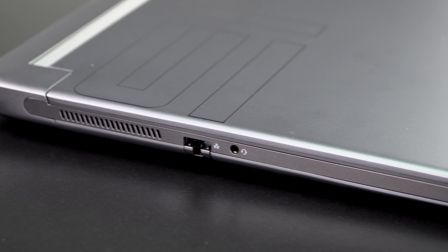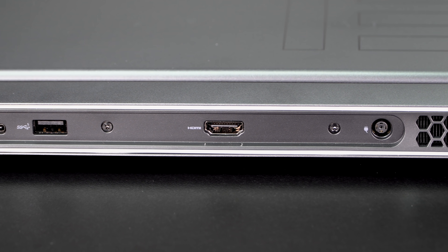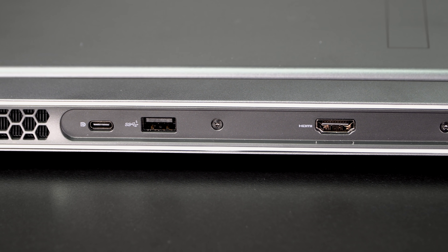We have 2.5 gigabit Ethernet on board, which is pretty darn nice. HDMI is 2.1, which means it supports 4K at 120Hz — for those of you with fancy OLED TVs. For those worried about the base model with no MUX switch and no switching to DGPU-only mode, which can be a hit of 5 to 10 frames in some games especially at 1080p — have no fear. Both the HDMI port and the USB-C port with DisplayPort are connected to the NVIDIA RTX GPU, so you can get your max frames that way.